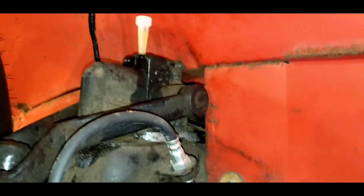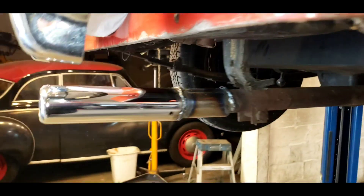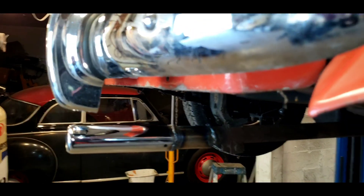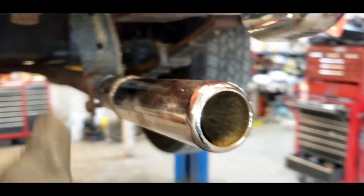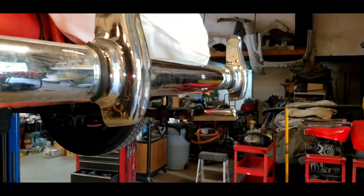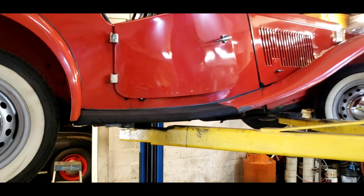On the back side, I got my welder warmed up and I extended the exhaust out beyond the bumper. The exhaust ended right about here and I was afraid it was coming into the car — the customer was complaining of an exhaust smell. It's still hot and smoking. We have a little chrome exhaust extension; I hope it doesn't rub on the ground. It's got to get beyond the overrider. I think that's going to do it. The next thing to do is take this for another drive.